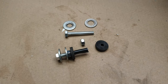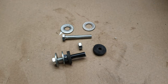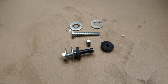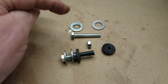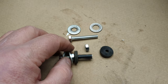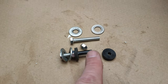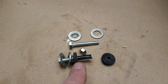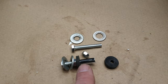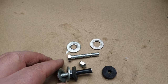To secure the headlight a bit then, if you check out the price of headlights, they're actually quite expensive, and you do see quite a few of them that have got these tabs broken off anyway. So what I've decided to do was to put a bolt through in the steady that holds the clocks on. So to sandwich it between two washers, and then have a rubber washer and the bolt thread covered over, so that it actually prods into where the broken hole is. There's loads of room in there, because they don't go anywhere near the headlight itself, so that when you put the headlights on, that prods in. Let me just show you how that would go.